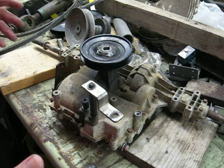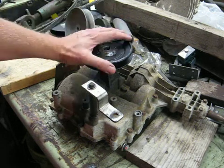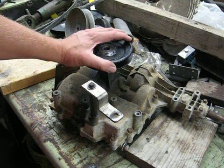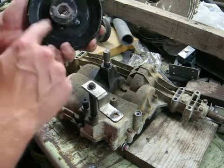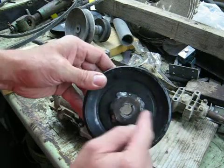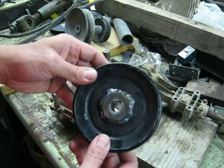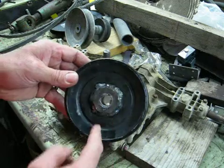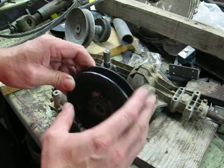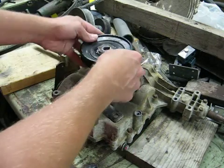I've done it 1-to-1 on other things. I've got a go-kart I made that runs right at 20 miles an hour with a 1-to-1 setup. I did use a cast iron pulley on the back end of it — you'll get better belt friction and grip out of a cast iron pulley than out of these stamped steel ones. This one is the weld-together style. I skip-welded to spread the heat out as I went, so I've got 8 welds on there that are each maybe half an inch long. Stay away from the cast aluminum pulleys like you get at the hardware store that have the spokes in them — they're a joke. They also don't have any extra diameter out here to let your belt guides hold your belt into the pulley when you step on the clutch.